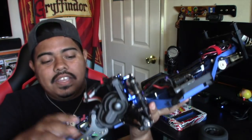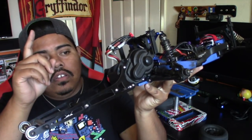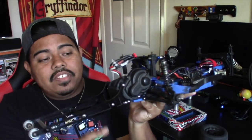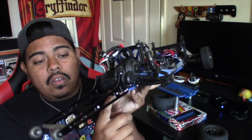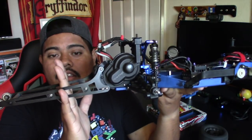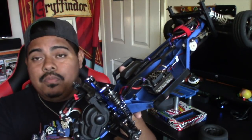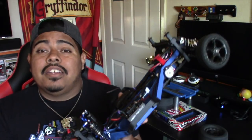The last thing you guys have seen in previous videos: I do have the RC Racing Innovations wheelie bar, specifically made for the RPM bumper mount. These have been lifesavers - a real difference maker. I used to have the Traxxas wheelie bar, but it only came to about right here and allowed a lot more movement - my front would come up a lot higher than it should. Adding those extra three or four inches has kept me nose down, straight ahead, and has been a lifesaver.